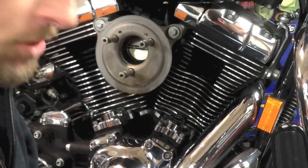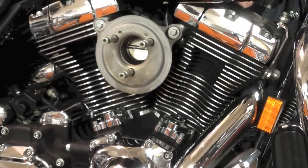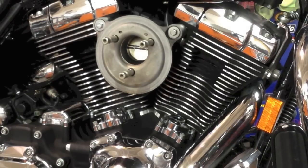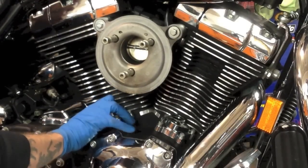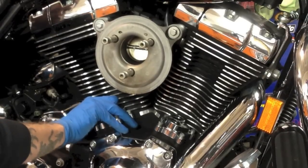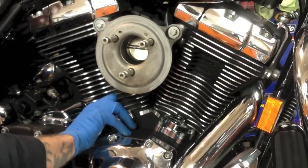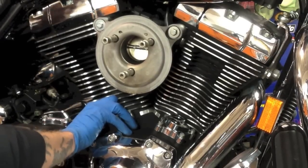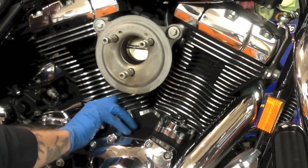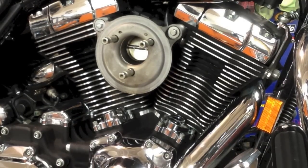Quick video on how to do some adjustable push rods. I use a cheater — these are Andrews easy install push rods. I put my fingers down in here so I can feel when the lifters are at the bottom. That was actually the compression stroke — there's a lifter coming up, lifter going down. We're in sixth gear, top gear. Both lifters going down means compression. I'm verifying that the piston is at top dead center.